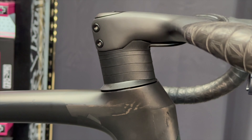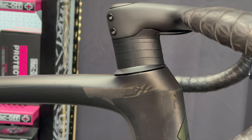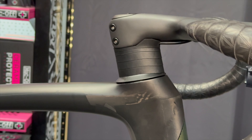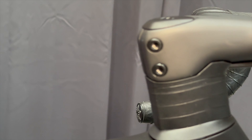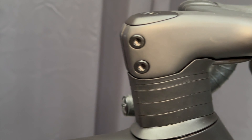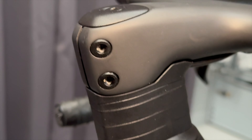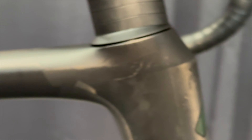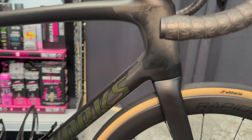He's also got a bracket mounted underneath. The customer has had bike fits elsewhere and has a specific setup he wants to use — 35mm of spacers, all cut to length. There's no chimney on there as we'd normally have; it's cut down just underneath, with the cut above the top bolt. For the headset, it's got CeramicSpeed headset bearings in there, which should give much more life than standard steel bearings.